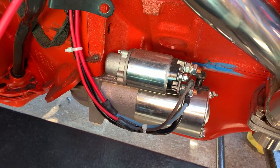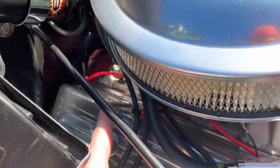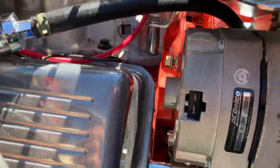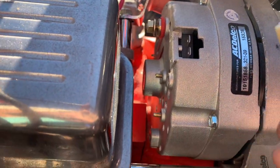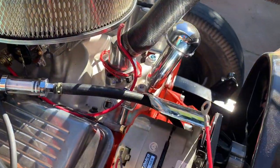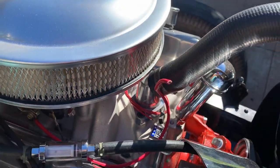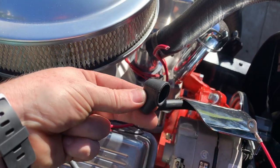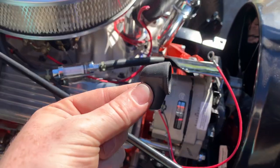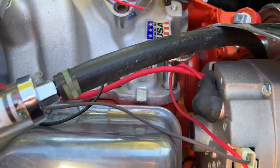Starter wired up with the power leads going to the fuse box. Getting to the alternator right now — ran it up and around through here, got the lead. About to wire up the alternator with the supplied harness — it plugs right in. The lead red wire that comes off this harness is going to share the power, so it goes in there with this wire and we're going to tee it all together with a nice rubber boot — fits in there all nice, looks factory. Got all the wiring for the front lamps, turn signals, parking lights all ran, and the alternator wiring all tucked in there nice.